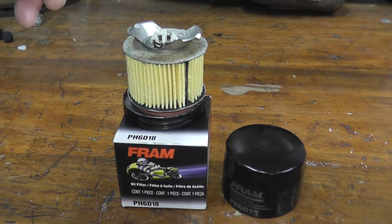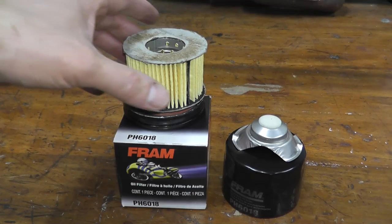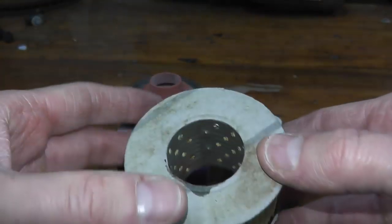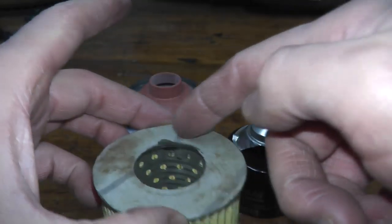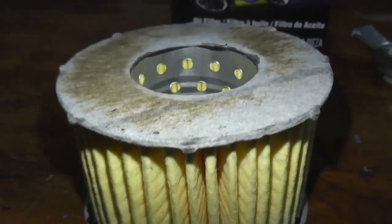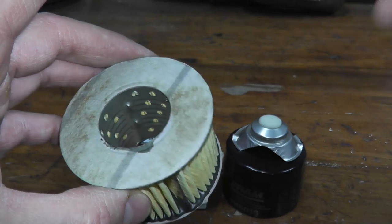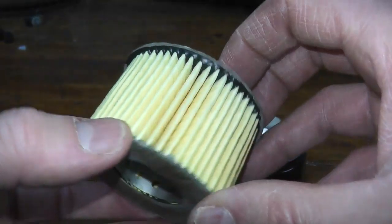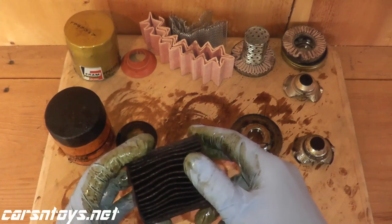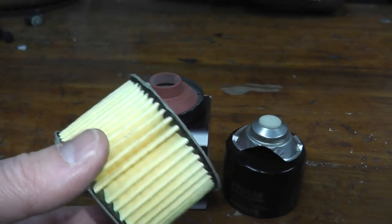Don't forget — with a lot of motorcycles the engine oil is also shared with the transmission, so you typically find a bypass valve on most filters for most bikes, cars, and trucks. Now this is a sticking point for a lot of consumers: you have end caps on these oil filters — one end cap here, another end cap here, and then the center tube. In this case the center tube is metal, as with most filters, but the end caps are not metal. They use these cardboard-ish end caps, and that turns off a lot of people from Fram.